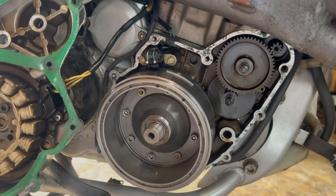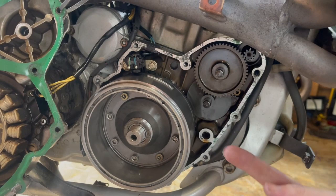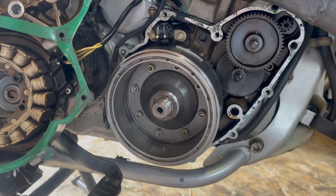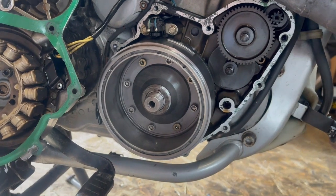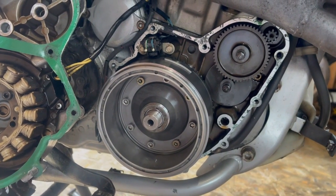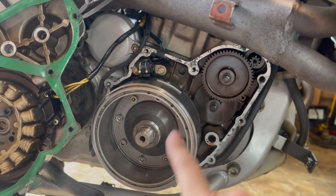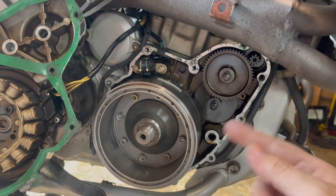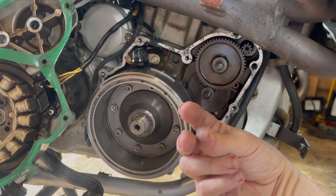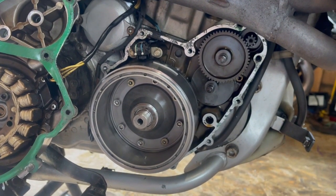You have to get the torque very specific, and the way to do that, there is a bolt on the other side of the engine, an M8, and you remove that, and Aprilia make a special locking tool for about 40 quid, and it screws in. If you're at top dead centre, there is a notch in one of the crank weights, I'm guessing, on the other side, and the tool screws in and locks the flywheel.